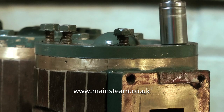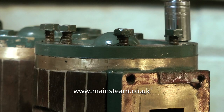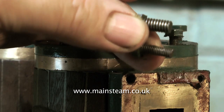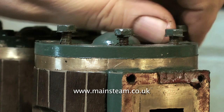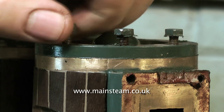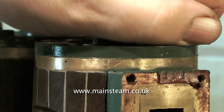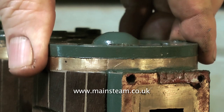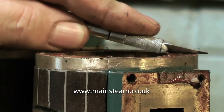Time now to take off the cylinder head and have a look in the cylinder. These are hexagonal head bolts — exactly the same as the bolts used to hold the exhaust pipe and the inlet pipe to the engine. The cylinder head bolts are all two BA sized bolts, apart from this one — this looks more like a quarter Whitworth to me. So it looks like at some stage someone sheared off one of these bolts, drilled it out and re-threaded it quarter Whitworth, which is not a problem — at least it saves me from doing it, and because the hexagonal head is the same size it won't show at all. I do notice that the cylinder head comes off very easily, which really is evidence that someone's worked on this part of the engine recently.